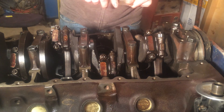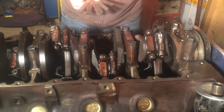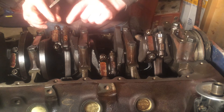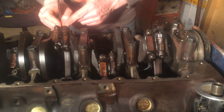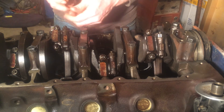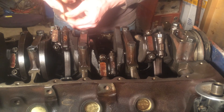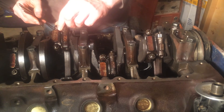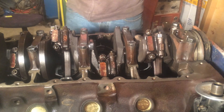The clearance is between 6 and 20 thousandths. So just go ahead in between your two caps and just slip a feeler gauge in there and see what you get. I've already gone through and measured this but I'm just demonstrating. 10 thousandths has a good fit there, so you just want to measure between all of your caps.